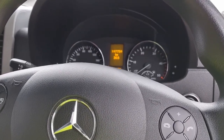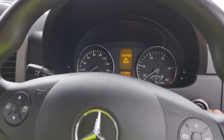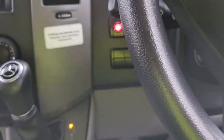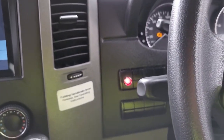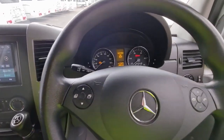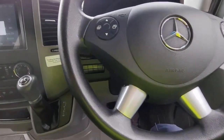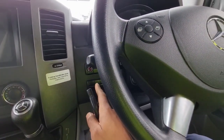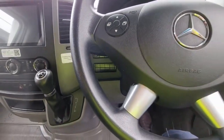On this camper here you can see we're plugged in. If you forget the vehicle is plugged into power and try to put it on ignition, watch what happens — you basically get a warning buzzer and a red light illuminates. This is just to warn you that it's still plugged into power and you've forgotten to unplug it. So if you ever hear that buzzer, that's what it's from — you've forgotten to disconnect the power from the 240 volt mains outlet.